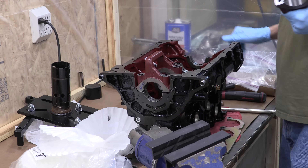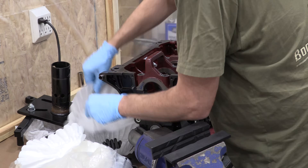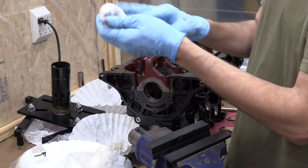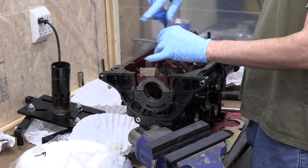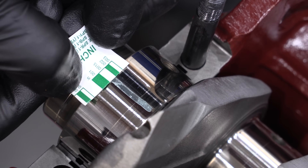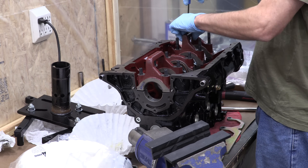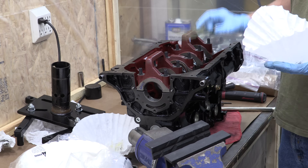The point of this video is supposed to be about PlastiGage and whether or not it's useless. My example proves that it's impossible for PlastiGage to give you an actual measurement for your oil clearances — we all just busted PlastiGage lying, and I thought this was a useful example that the internet needed. These precision measurements, along with a set of feeler gauges, just told you how and why it lied. But even when everything fits perfectly, the measurement you get is still just your own fudged estimate based on the width of a stripe printed on a poorly graduated piece of paper. What value does a $5 test in an hour of your time have if you're spending thousands of dollars building an engine? I'll leave that up to all of you to decide.